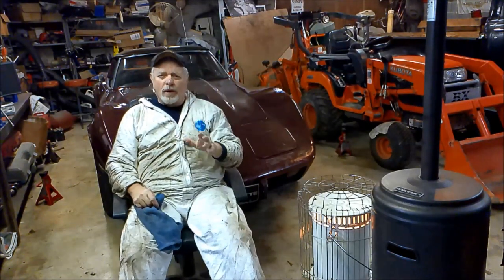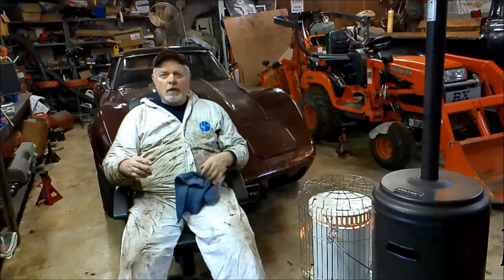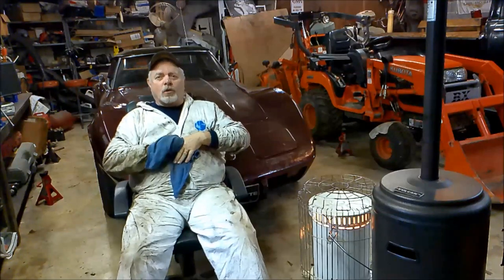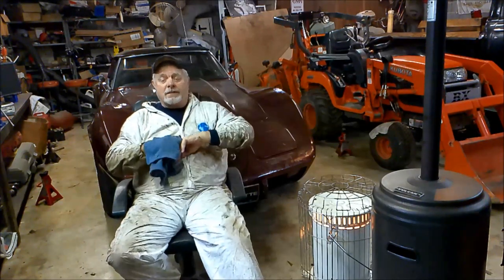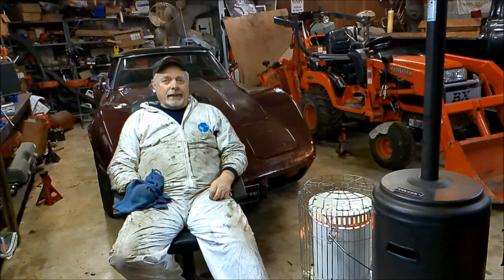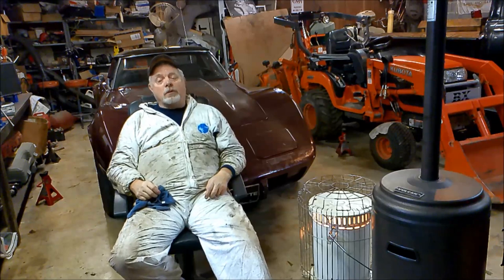Now, when I did the rear wheel bearings on this, I put the shoes and all the hardware in the hub before I put the rear axle bearing assembly back together. That way I didn't have to work around the axle flange trying to get those shoes in. I've seen some videos on YouTube where some guys have been able to do that. My fingers aren't as nimble, aren't as small. There's no way I could do it, so I did it the way I did it. And I tie wrapped the actuating lever back until today, till I got the new cable installed.